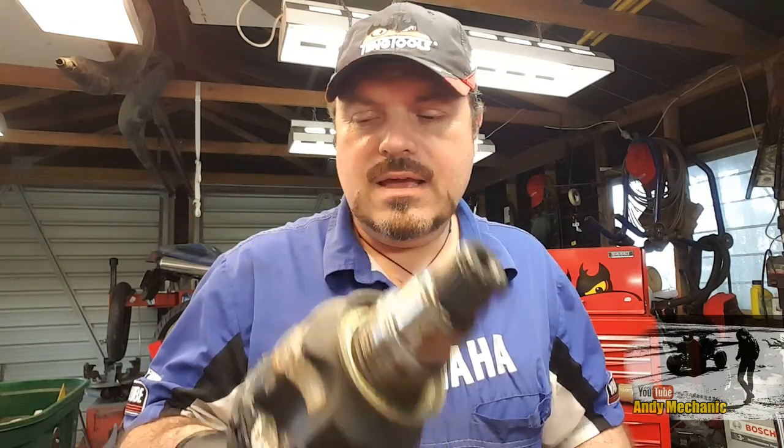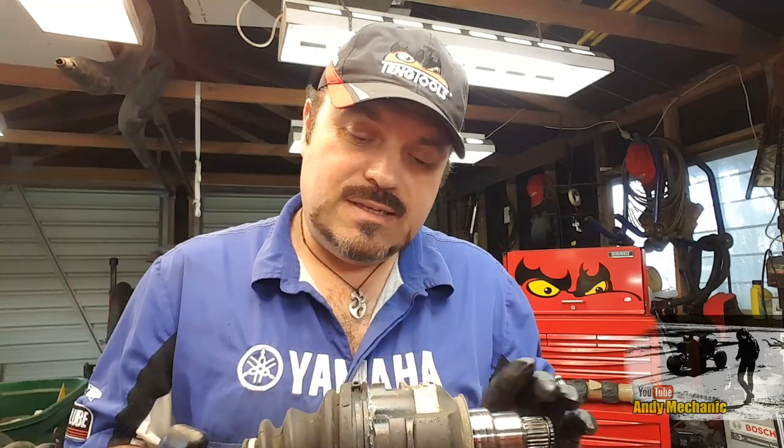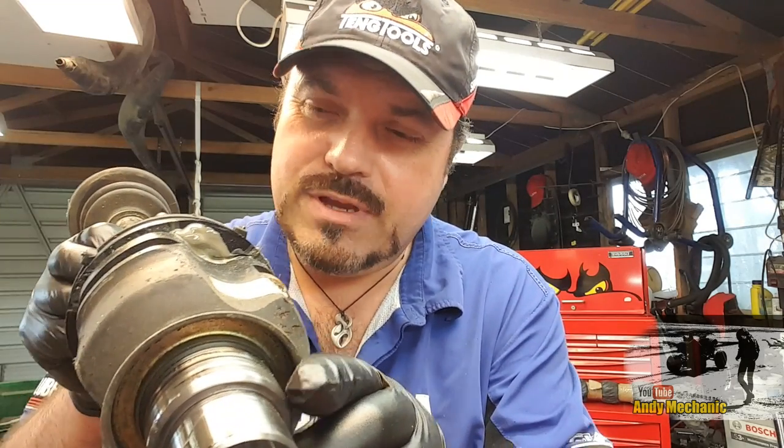Now, I've just dug out one more of the other front drive shafts off the infamous RAV4. And for those of you that were really, really astute, on one of my very first videos that I made back in December 2015, I ran out of those little clips and I cheated and did what a lot of garages do, and I used cable ties, and that's bad. And you can see why it's bad. Can you see that the grease is leaking out because there's insufficient pressure holding that boot in place?